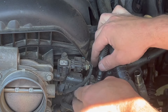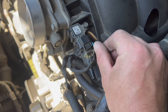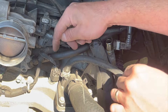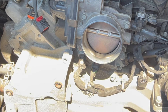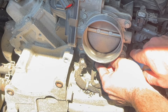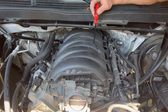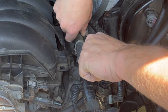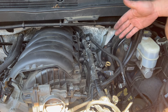Take off this hose. This one on top has a little blue tab — push it out to the right and then press it down and pull it up. There's another clip by the water thermostat — press that and pull it up. There are two more underneath here with a red tab. Something that is not standard on these LS engines is an oil catch can, which is also highly recommended — it definitely helps the engine's longevity. It's got two breather lines to disconnect.